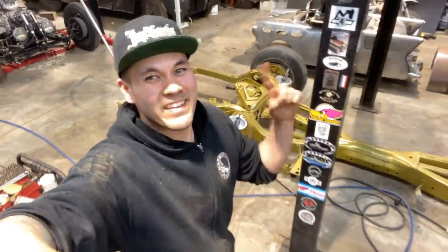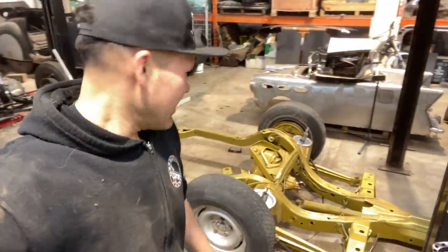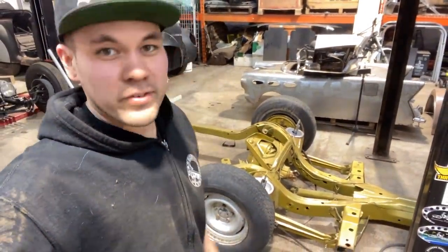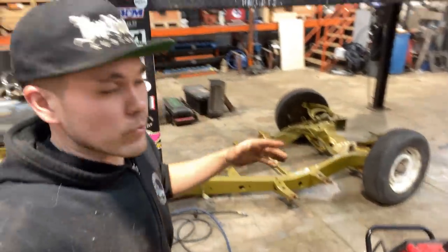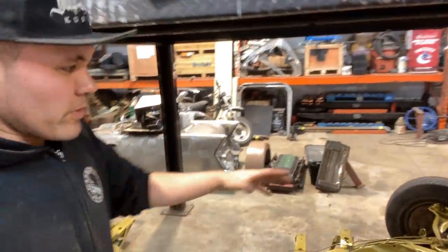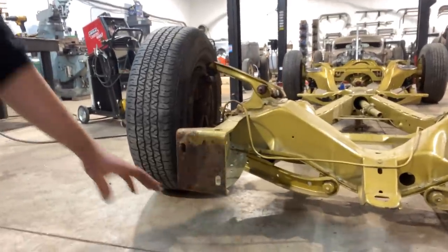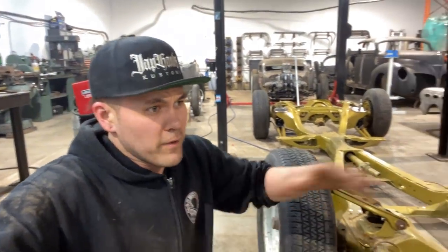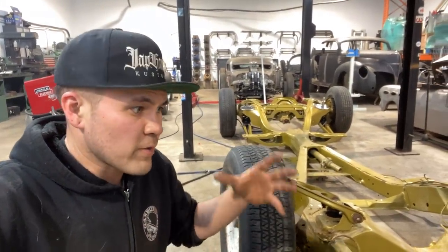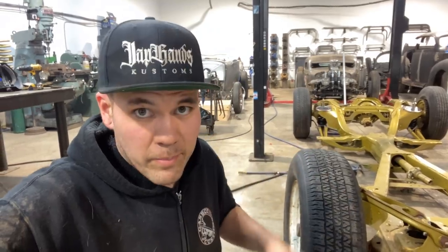Okay, well that is it for doing hydraulics on the rear of Kristina's 1960 Cadillac. We did the coilover setup, stoked. It's all done. Next up is gonna be the front. The front's gonna need a bunch of work. That'll be the next video. We're gonna try and get a little bit more low out of it. There's a few things we're gonna have to do to get that, and we'll go over it next time. But basically, we're gonna start cutting pieces of the frame away that we don't need, figuring out where the cylinders are gonna go, and reinforcing the lower A-arm to accept the coil for the coilover setup for the front.